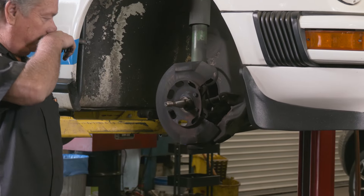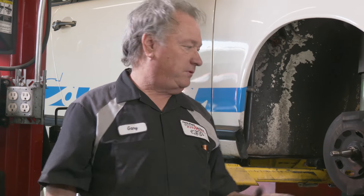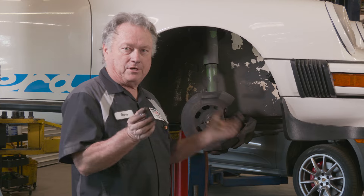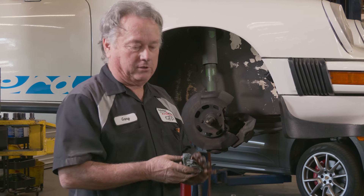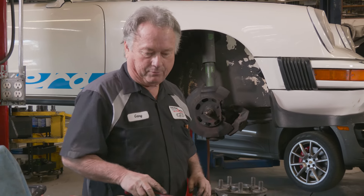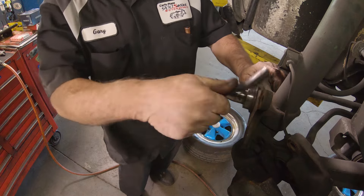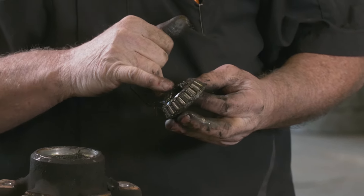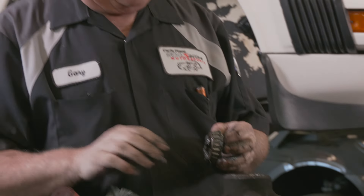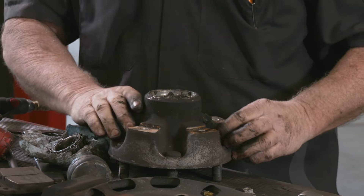His is kind of rusty, but as we keep working on the car, it keeps improving — better and better. People like that we do the little bit extra. Rather than just doing the job and throwing it back together, he'll be able to see the difference — it'll look better, look cleaner. And once again you can see the brown, which is a sign water's been in here. So I'll clean the bearings all up and inspect them to see if they need to be replaced or just cleaned and repacked.